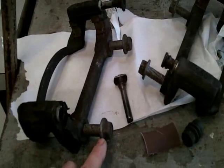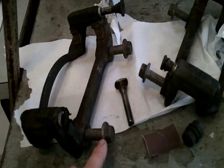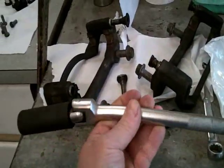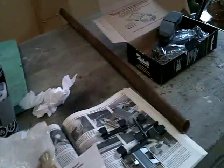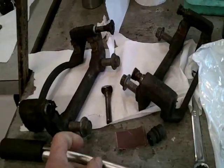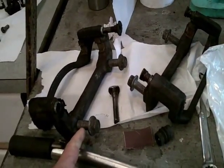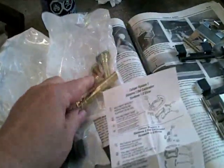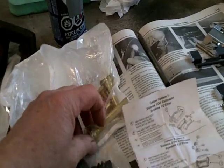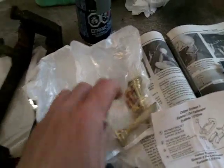These are the bolts that hold the brake caliper bracket on — they're an 18-millimeter head. I had to use a breaker bar plus a cheater bar on the end to loosen them off. When you get them out, make sure you clean them up and use never-seize. I'm also going to put never-seize on the brackets that hold the caliper onto the pin, so I'll grease everything up and never-seize those bolts as well.